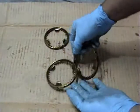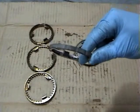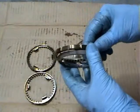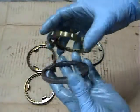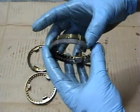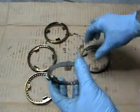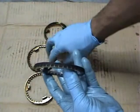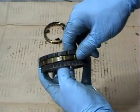These are even what the dealer gets. Now here are the new synchronizer rings. Here is a new third, fourth, fifth, and sixth — they're all the same. But if you notice, this style is different. You've got the old brass and you've got the new friction material, which is obviously going to allow it to grab gears a little quicker. This is actually an OEM update through the dealership. So anytime you get it rebuilt and you get the right parts, it's going to be upgraded. This one is really aggressive for first and second — both first and second gear have this versus the old first and second, where one was brass and one was a milder friction material.